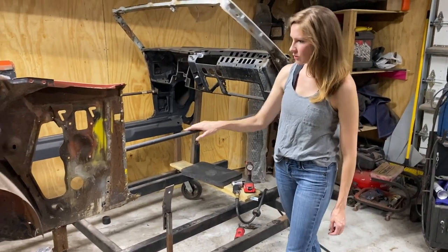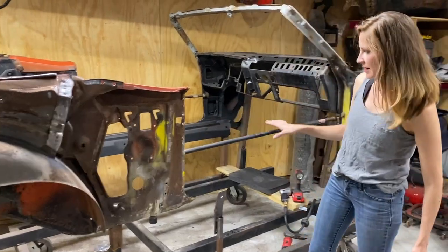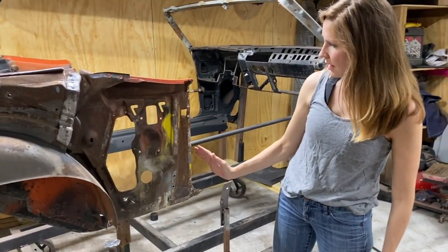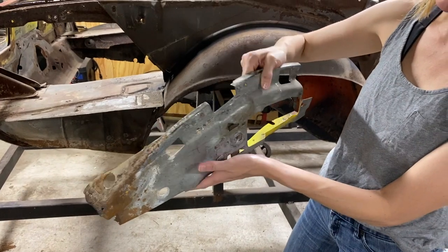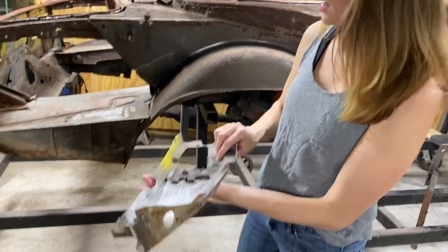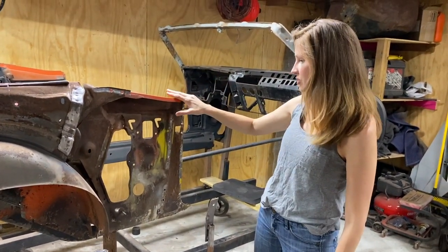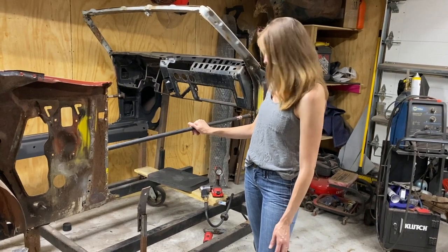This is the horizontal support piece that we welded on the A pillar and the B pillar, so we have a frame of reference. We removed the quarter panel, as you can see here, since we're going to be ultimately replacing this one. Then the quarter support door jamb - they do not make this in reproduction, so we have to be very, very careful when removing this one. This is unique to a convertible. As we mentioned earlier, there are a lot of things to take into consideration when working with a convertible, because you don't have a top. You have to be very careful when removing structurally important pieces like the rocker panel that you have frames of reference in place, such as we did.